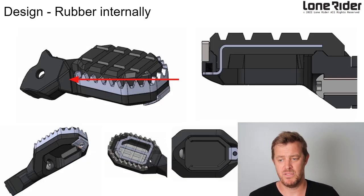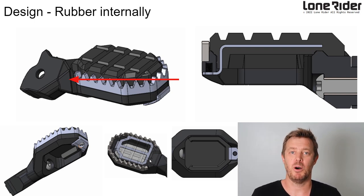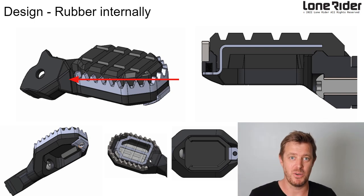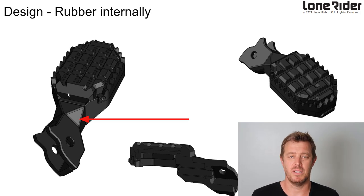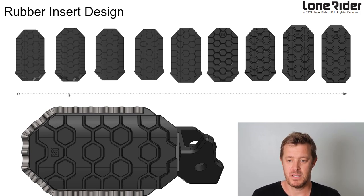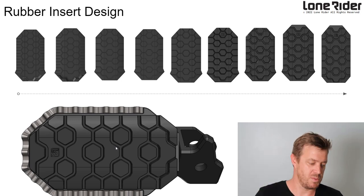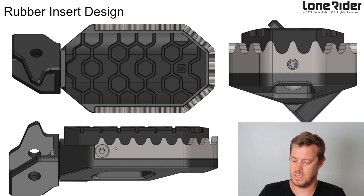We were also looking at the rubber inserts. First I designed something you had to screw in to keep it fixed, but feedback was that nobody wants to get under a dirty bike after a hard day of trail riding and deal with small screws to change the rubber. So the concept became plug-in. The first concept looked a bit like a chocolate bar. The second concept moved to a honeycomb design, which gives you grip in six directions. I started very simple and moved the design all the way to a finished product. I tested it — really good, really strong and grippy. It's in there now but you can just remove it and put it back in with no tools.